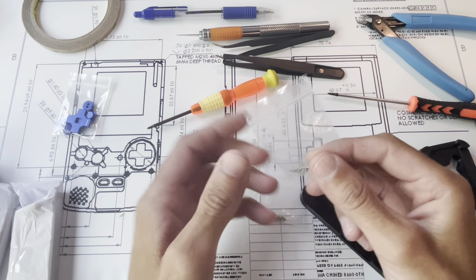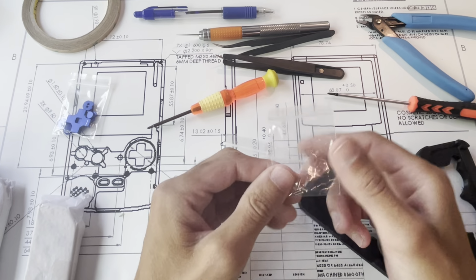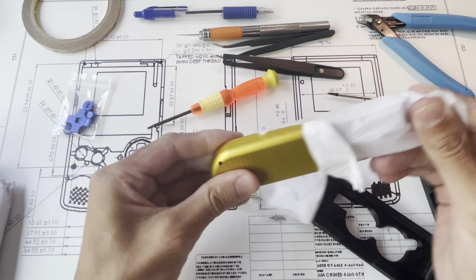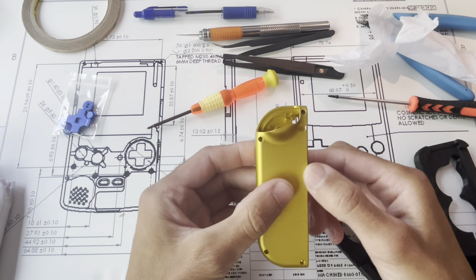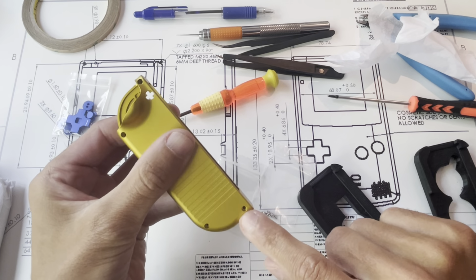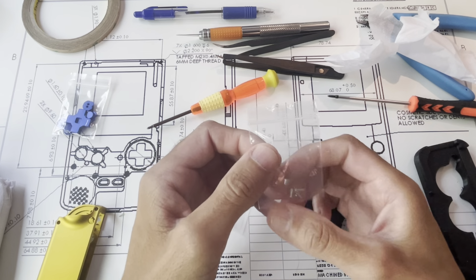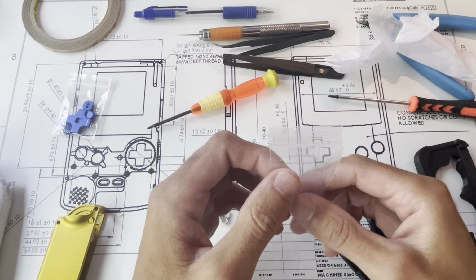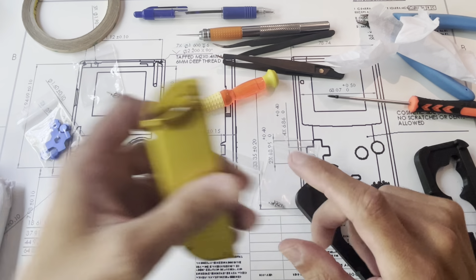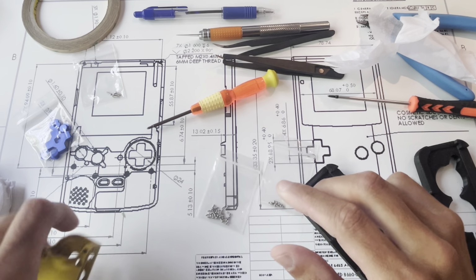One of the common questions I get is, I'm missing fasteners, because intuitively you think this longer fastener attaches the two shells together, the four fasteners that hold the front and the rear. So these four holes actually use 3 millimeter fasteners for almost every hole, and use 5 millimeter only in this bottom hole. So I intentionally left out not many fasteners. I only put in a few so that you'd either question me or go back to the installation instructions. If you're trying to force a 5 millimeter in some of these holes, chances are you're going to break a fastener or strip the thread.